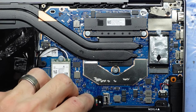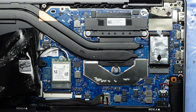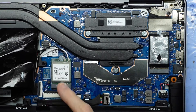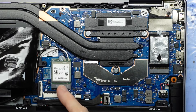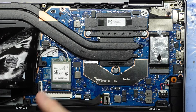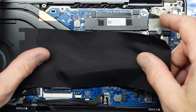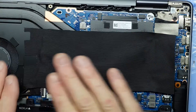From there we reconnect the battery. You're either going to have to clone the NVMe drive prior to installing the new one, or you're going to be doing a fresh reinstall of Windows after the fact. Also to note, the Wi-Fi card is replaceable — very similar to the NVMe drive in how you do it. Disconnect the two antenna cables, flick them up, undo the screw, it lifts up and out, and a new one goes in. This one being a Wi-Fi 6 card, there's probably really no need to upgrade it right now.